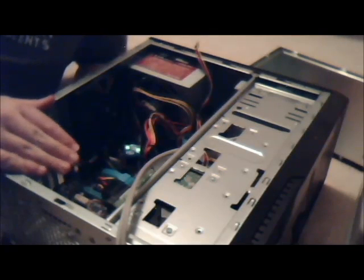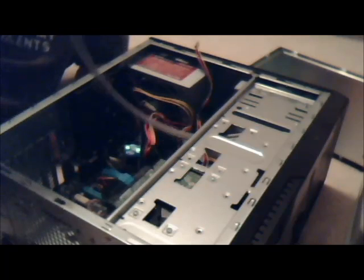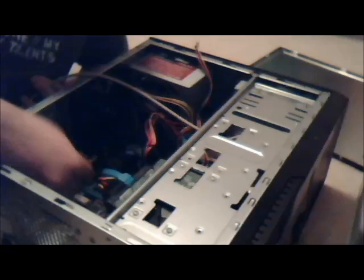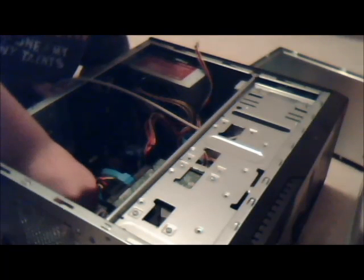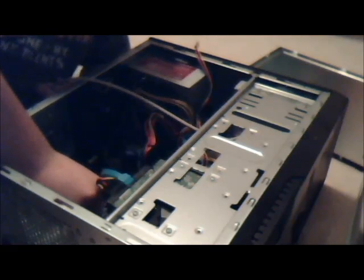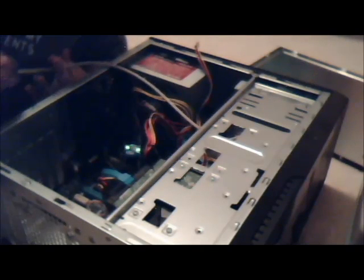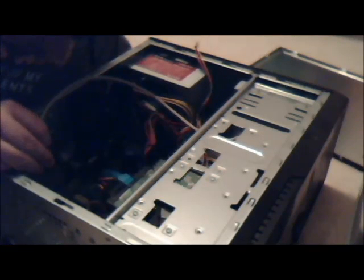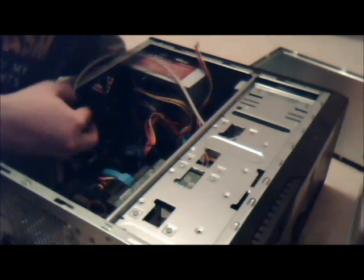Anyway, let's get the fan mounted. Wait, these. Forgot about these. Now these are really easy. That says USB. Plug it into USB 1 on the motherboard. Only fits in one way. Okay, that's done. And then this one says it should be HD audio. Yep, so plug it into HD audio on the motherboard, which is usually, yep, up here. Once again, it fits in one way.